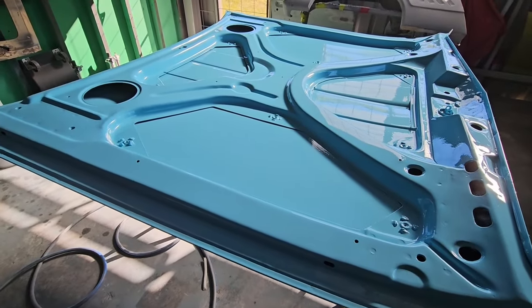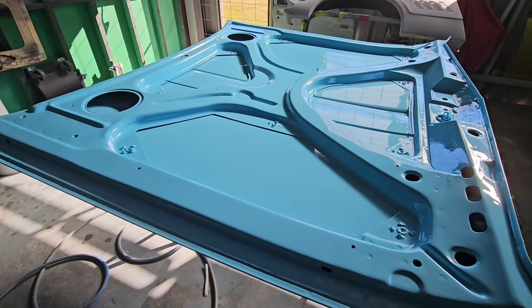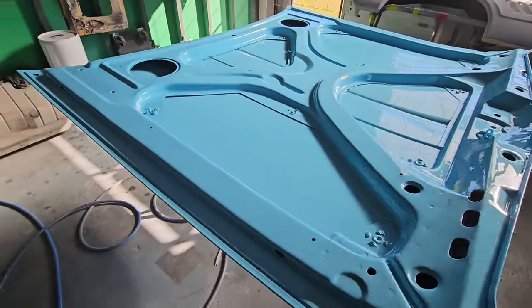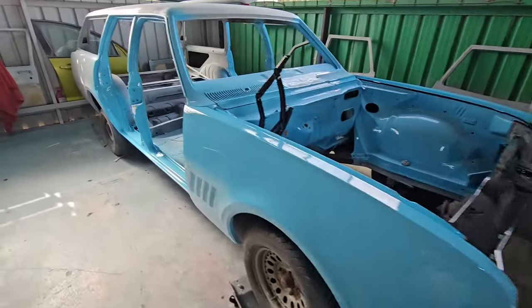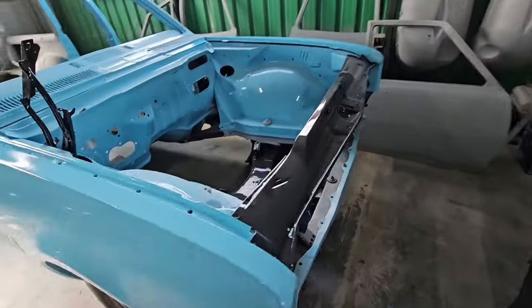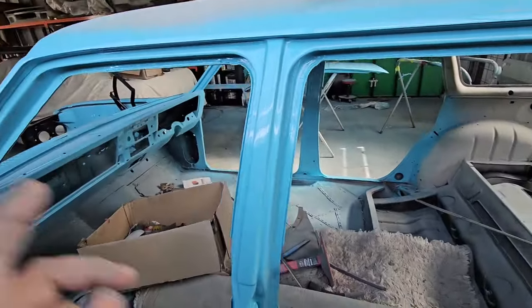The reason I'm doing it panel by panel is not about the colour - it's the fact that I didn't have that primer go off properly. I've been sanding everything back and doing it all in one coat with fresh primer, then waiting a day and throwing the base on it. Got it partially done, just letting everything do its thing. Jams are done, still got roof to do, rear quarters, and most of the inside is done.